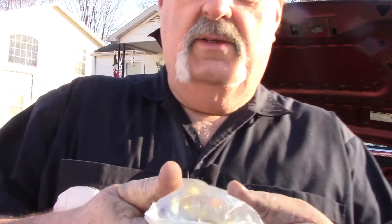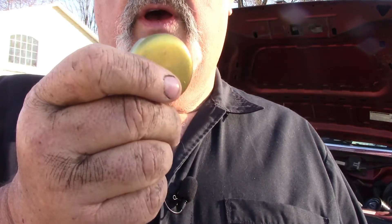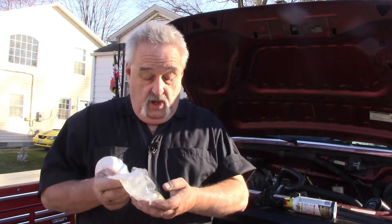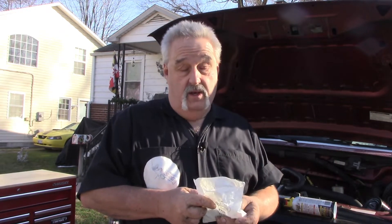This is what you have for real freeze plugs — they're all in the bag here. So this here goes in the hole where that rubber freeze plug is. There are other ones that come with it, but I bought the brass ones. You can get the steel ones, the same ones that come from the factory, but the brass ones are better because they'll do the same job and you don't have to worry about them ever rotting. Why this has rubber freeze plugs in it, I don't know. They're easier to install, but they're not a good idea. We'll go through the whole thing — how to get rid of them and put the right ones in.